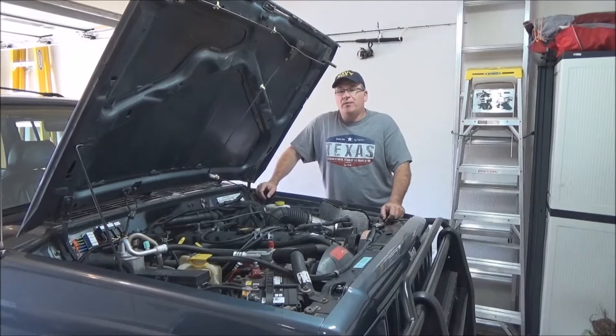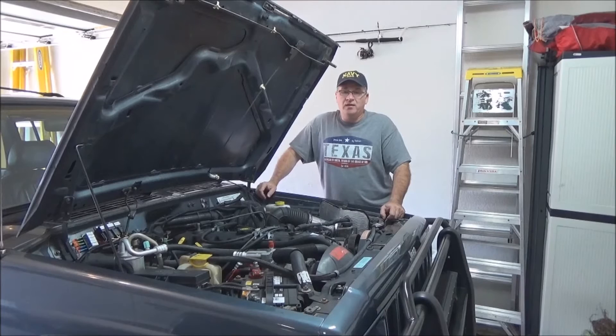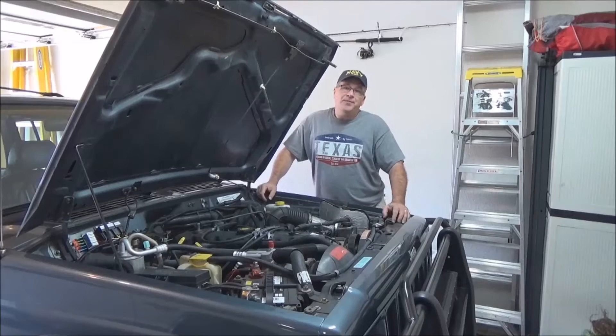We're talking specifically about the 1991 through 2001 Jeep Cherokees with the C-clip rear end. Cherokees built from '84 through '90 had bolt-on rear axles — the axle was actually bolted at the end of the axle tube, and the bearings were pressed onto the axle, unlike the C-clip rear end which has floating bearings at the end, and you just slide it in after you pull the C-clip off.